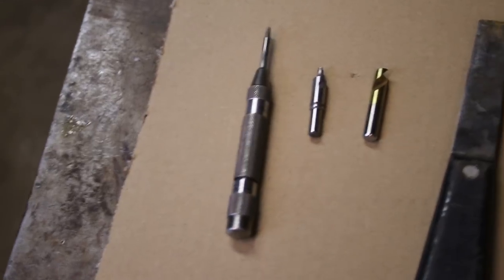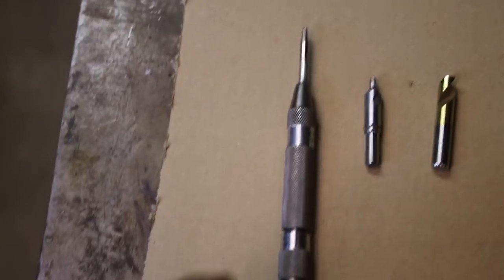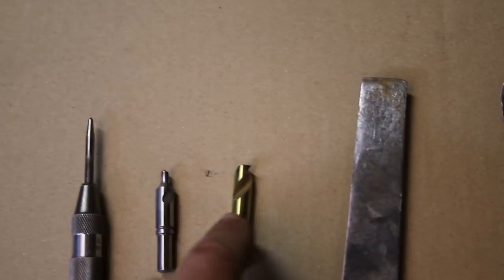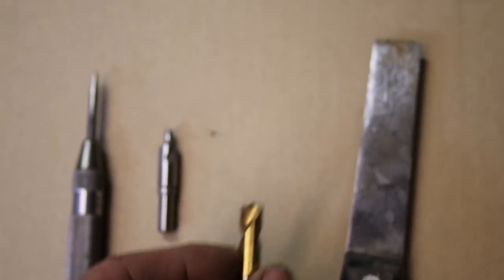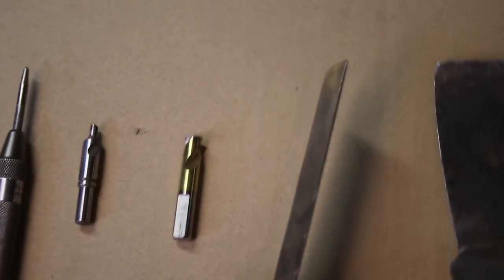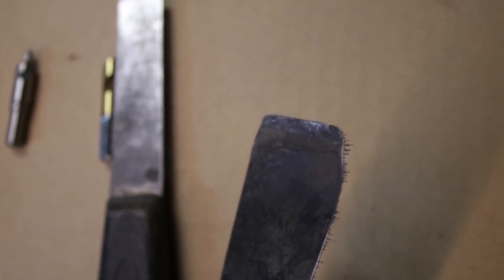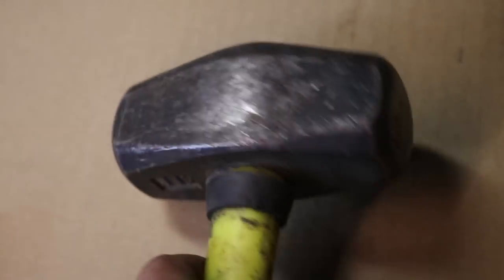Here are the tools used to take off that panel. Because this is such a common repair, I want to make sure you know exactly how I did it. This is a spring-loaded center punch. This is a center drill or countersink — short and stubby to create a little pilot hole. This is the spot weld cutter — it does have a point, but that point tends to wander, which is why I start with the center drill first. And then this is a heavy-duty chisel — kind of a cross between a chisel and a putty knife, made by Hyde. This actual putty knife is much thinner and good for tight-fitting panels. And this hammer is pretty heavy, just to get things done quickly.